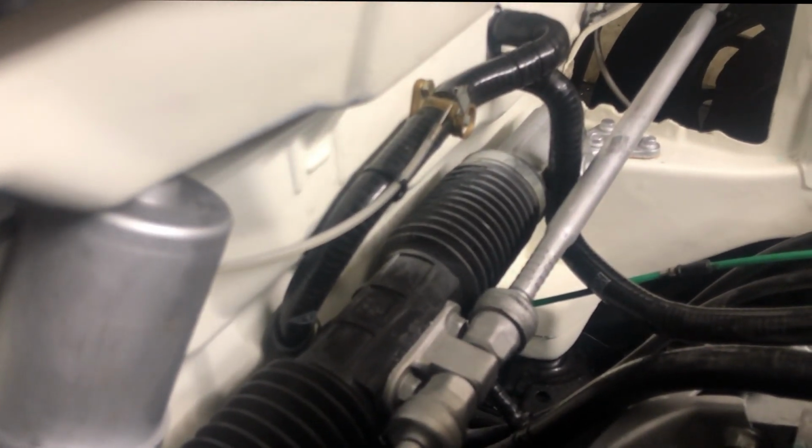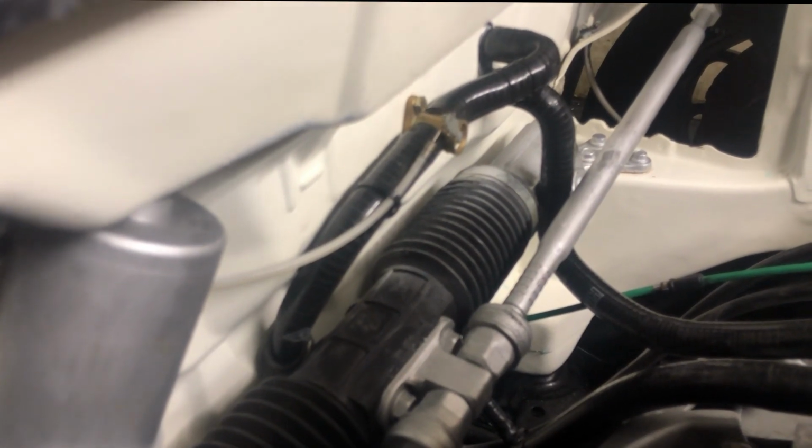So that valve, I'll show you while I'm here. The heating is currently on warm, so if I turn it to cold, that valve will start moving. See how it's pulling it back in? So when it's cold, it closes the valve to stop the hot water going through, and then if you just whack it back to hot, it opens it up again. That's not the quickest of valves, but it does the job. So that's all sorted. I'm glad I've kept that.